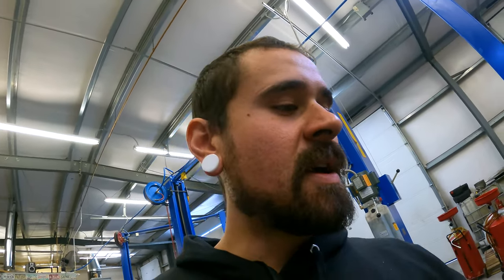spray it on the back side of the bumper cover and the front. If you use this on the back of the bumper cover, it will actually help dissipate a lot of the static. This stuff is obviously more job specific; it will strictly get rid of that static. Clean it really well, and then you can run your hand across the top of it, and you'll be able to feel if there's any static anywhere.